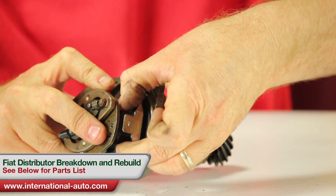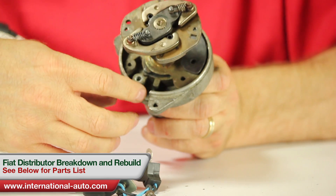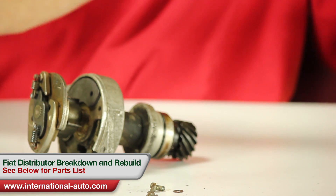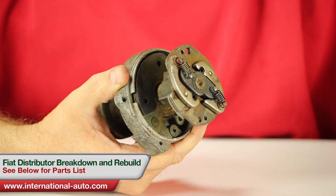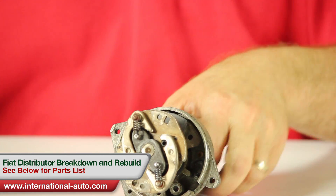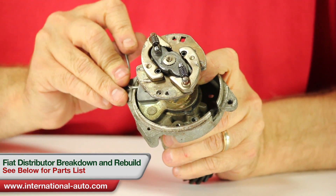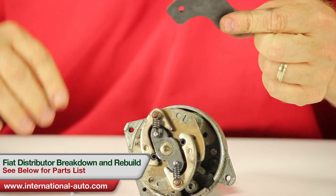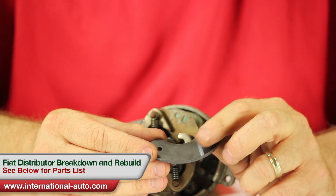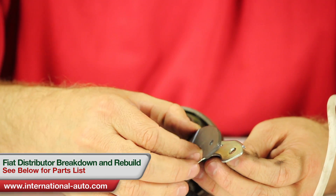Slide it out of place and the magnet is going to stick to the plate. You want to take your screws — because one of them is longer than the other, you don't want to get them mixed up — and put them back in the distributor itself so you don't misplace them. The magnet is still stuck here; I'm going to take an O-ring pick and slide it between the magnet and the pickup plate. The only thing that really makes these go bad is they crack, so try to keep it in one piece if you possibly can. Also, if there's a stripe on it, the stripe goes down when you're installing this in a Fiat — in other cars it may go a different direction, but in the Fiat it definitely goes down towards the plate.